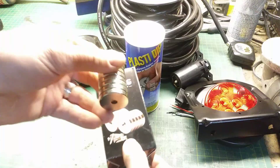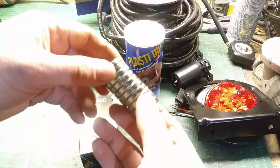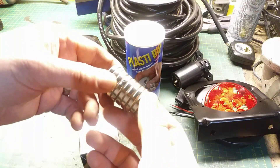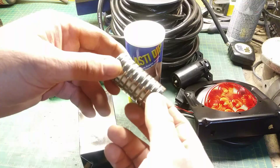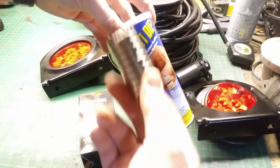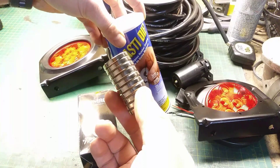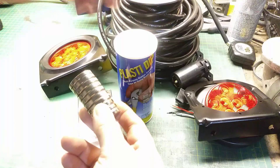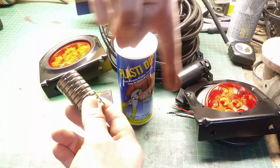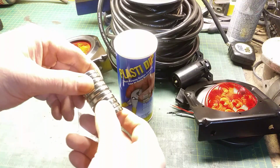The next possible issue I thought about is that the magnets could possibly scratch the top of the car. I originally thought about using the magnets that came with the original light kit, but quite honestly they just have a larger donut magnet and they're not very good — they really don't stick to the top of a vehicle very well. These neodymium magnets will stick extremely well. They cost a little more than a regular magnet, but they're still not very expensive. I'm going to take a little bit of Plasti-Dip and dip each one of them in, let that cure — that way when you stick these to the top of a vehicle, you won't scratch the top of your car. Look in the description down below for part numbers or links to where I got them.